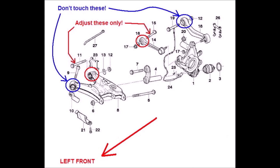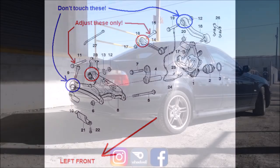On the left side of the screen you can see all the measurements for the E39 six-cylinder — V8s will be slightly different. For adjustment, the red circle on the lower control arm is the camber eccentric bolt (number 11), and the red circle on the right is the toe eccentric bolt (number 15). Adjusting camber can be done with the car on the ground, approaching from behind. If you have to jack the car up, roll it back and forth to let the suspension settle before re-measuring. Drop any questions in the comments below — hit subscribe and I'll see you next week.